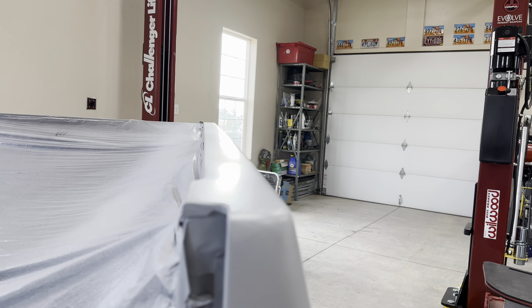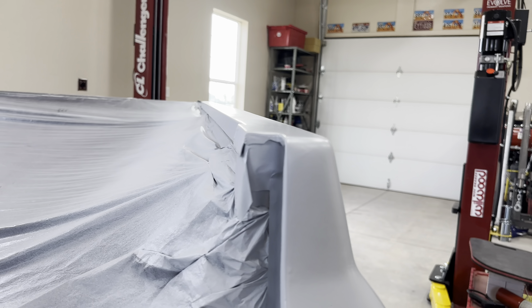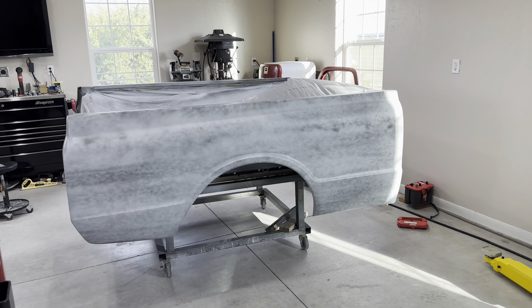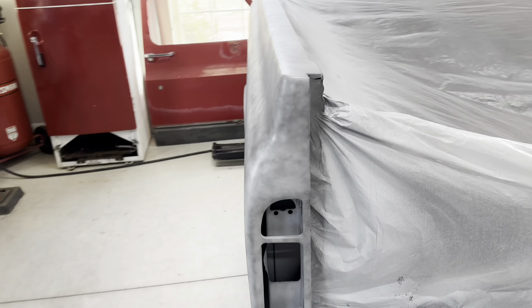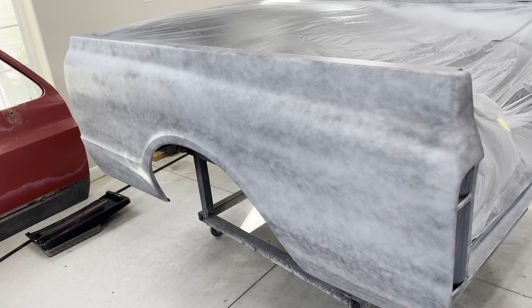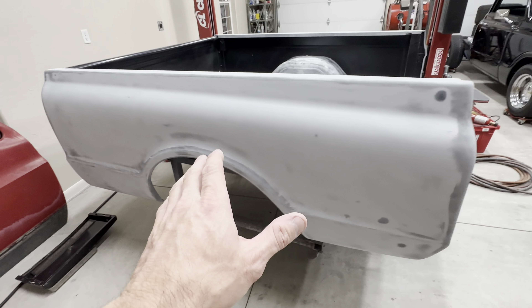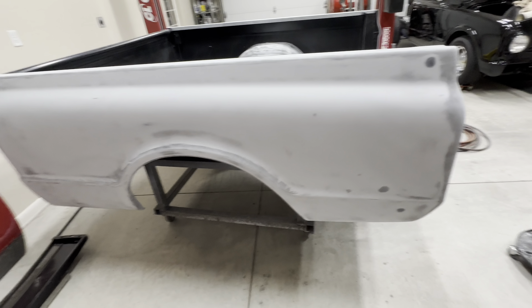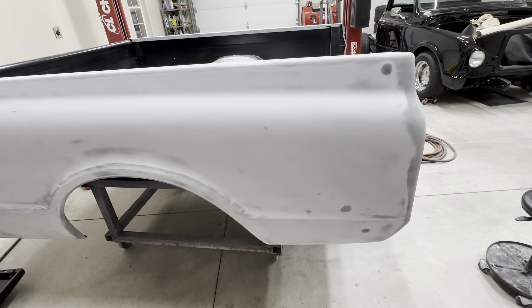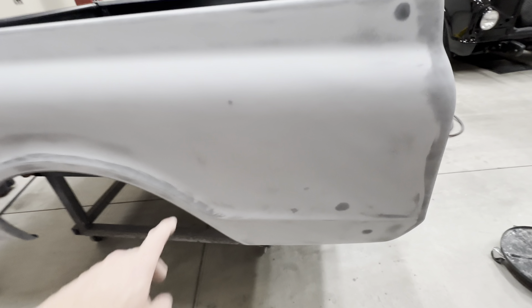The top rails look nice too — I think they'll sand out just fine. Here it is in guide coat, ready to start sanding, which is my least favorite thing to do. But at least it's further along today than it was yesterday, and hopefully it'll be in paint sooner than later. I just hit this roughly with some 220 with my block. I'm going to go ahead and go over it one more time, then go down to 320 and add some lightweight body filler to some of the low spots. There's not many on this side — there might be one that ends up right there, but that will probably come out with another coat of primer.